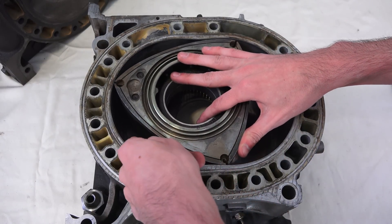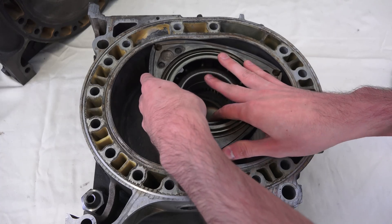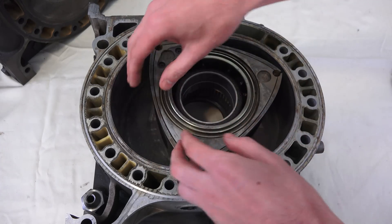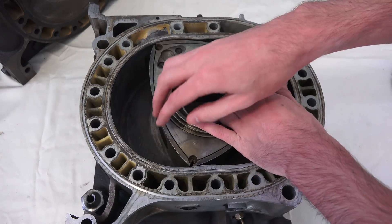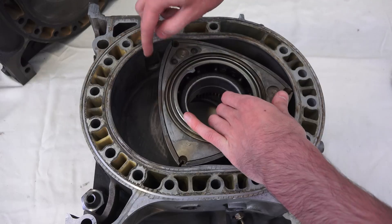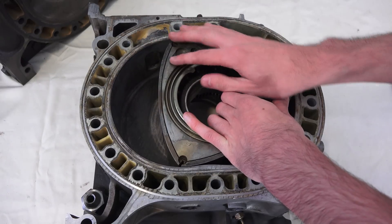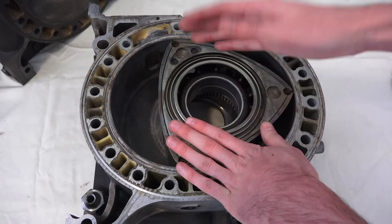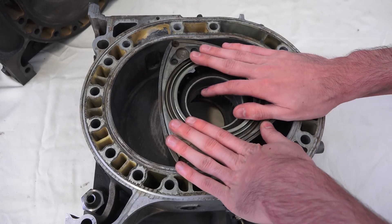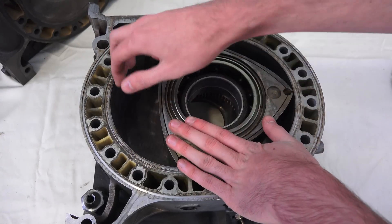The flame has to travel a long distance in order to ignite all of this mixture, and by the time it gets to the far end, you're continually making it more difficult to ignite that mixture. Then it reaches the exhaust port and some of that air and fuel is going to be unburnt, so you're going to be sending that fuel out the exhaust. This is why you may see rotary engines spitting flames out the exhaust — they're not able to burn all of that fuel within the combustion stroke.